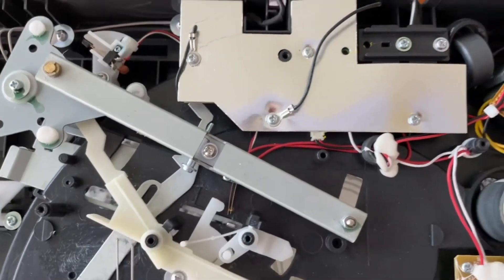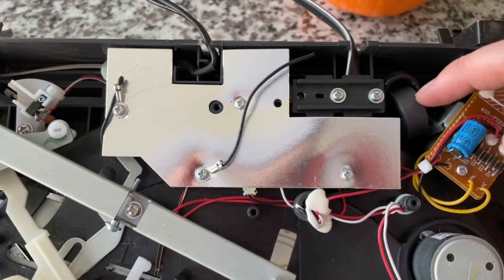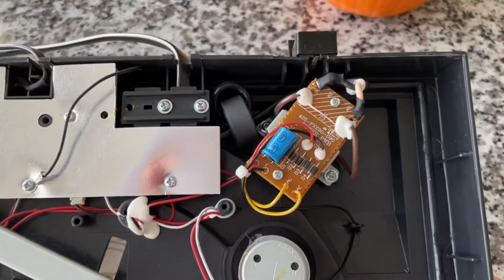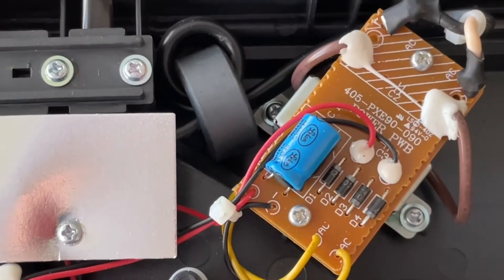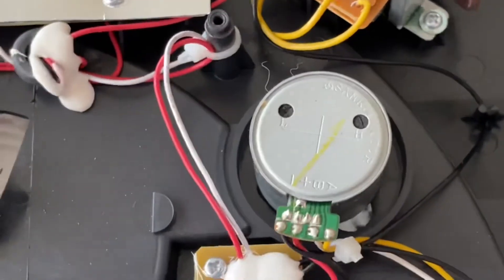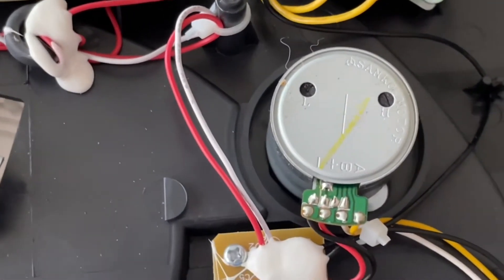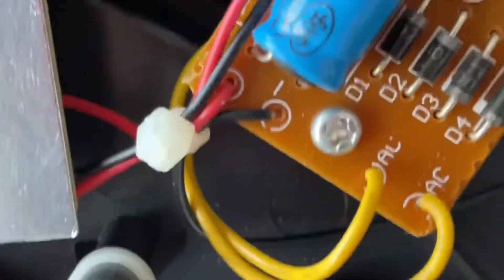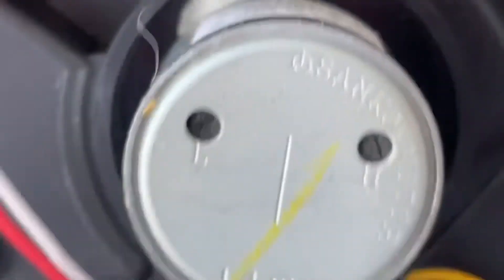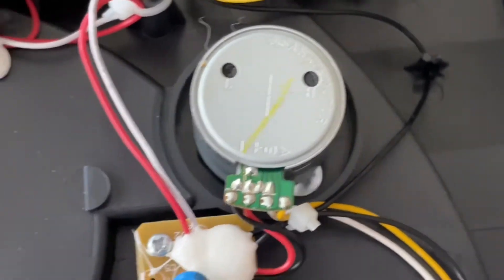There's going to be an IC under that shielded piece. There's a power supply coming in — something rubber related to the power, so you don't want to be touching things. Here's the power board right there, very interesting. We have a Sankyo motor — interesting, I'm surprised it's not a JYK like all the others, but it's very similar to a JYK. Looking right under the edge there: a 9-volt DC motor. And there are the trim pots for the speed.